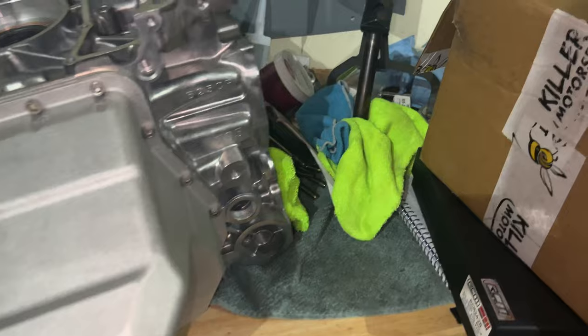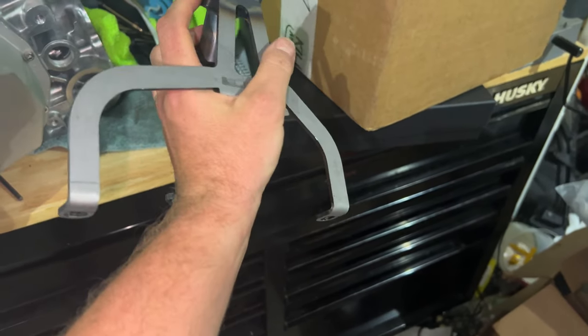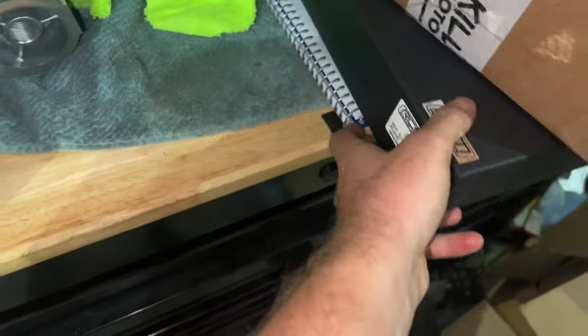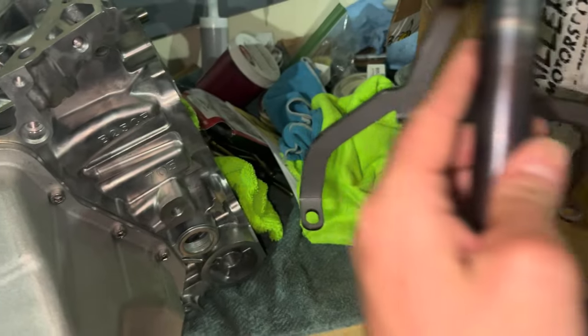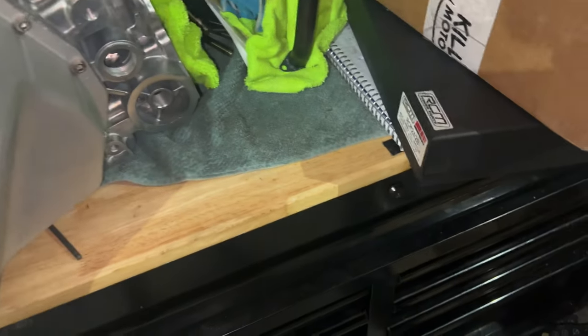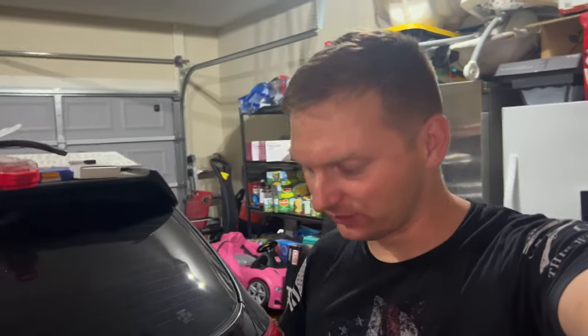I'm not modifying the windage tray — that would be bad juju. Instead I'm going to modify the baffle itself, which is a lot easier. I only have to cut out about a quarter inch on each side so the side rails can just drop in, screw into the windage tray, and go through the RCM baffle — which is so sick, I did not expect that. If you guys are enjoying the build and how things are finally coming together, drop a like, subscribe to the channel, follow me on Instagram, and I'll see you guys on the next one.